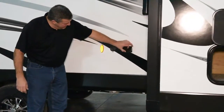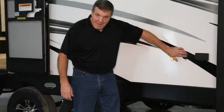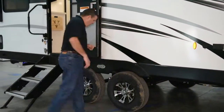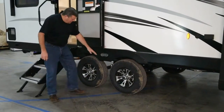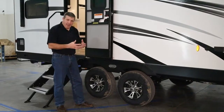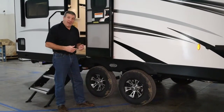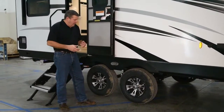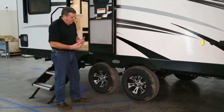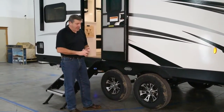You have 110 and cable output on this side in case you want to bring your TV out and watch the game or whatever. Tires are nitrogen filled, which gives you better tread life and more consistent tire pressure so you don't get tire wear from the pressure changing. Super lube hubs too — you don't have to pull the tires to pack the bearings or even adjust the brakes. It's auto-adjust brakes.